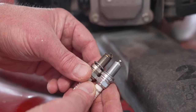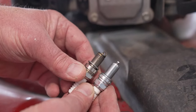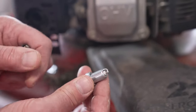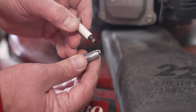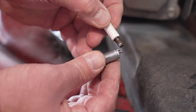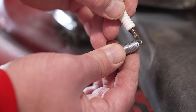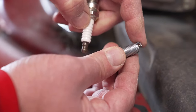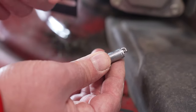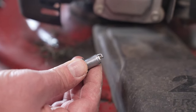That's the most important thing. If for some reason you grab a spark plug and the new one is something like this — longer or shorter — it's not going to work. One other thing: these spark plugs come pre-gapped. You see this little metal piece right here, and that little tab underneath? That's where the spark is, and there needs to be a little bit of separation between that metal and that little brass-colored tip. If you see that it's smashed down, you need to pull it up a little bit. There is a proper gapping that has to occur. Normally this won't be an issue, but I want you to check it to make sure.